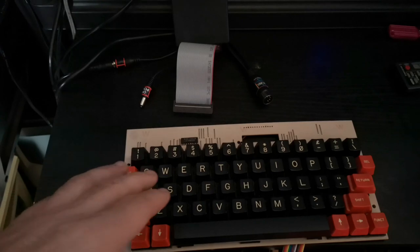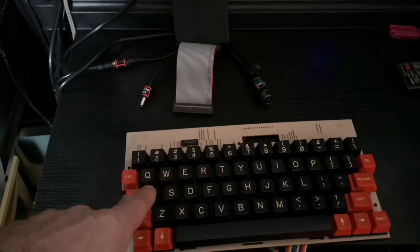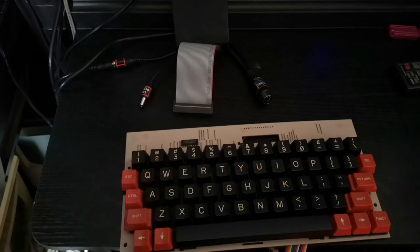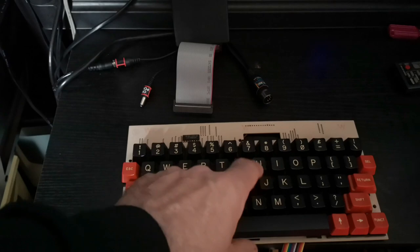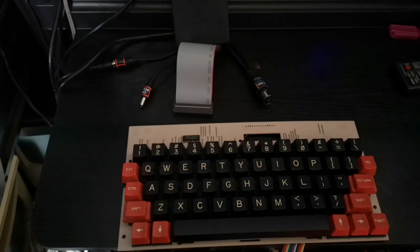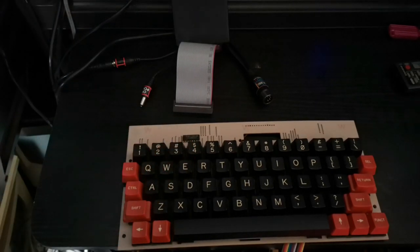They're not starting to get stiff or feel a bit clunky under the fingers, which is a giveaway: you can actually start feeling them when you press the key down. It's not smooth, and the key switch starts to lose its connection and starts dragging on the key. So it didn't feel like that kind of issue. Then once it started losing keystrokes on this side of the keyboard, that's when it got a bit worrying, and I decided to take the machine apart because the keyboard was effectively unusable.